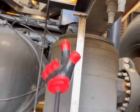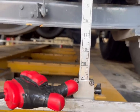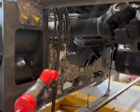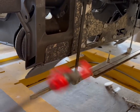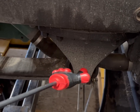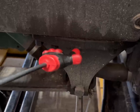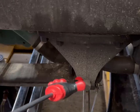Let's talk about gauge placement. The inside of the gauge needs to be touching the inside of the frame rail on both sides, and you need to be at the same line marker on both gauges. The back gauge should be slightly in front of where the front tandem is connected to the frame — this gives you a point of reference. The next gauge needs to be slightly behind the rear side of the front spring hangers. The front gauge needs to be at the front spring hanger. If you have a large cross member, you can hang it on the bolts themselves, since these bolts should be at exactly the same spot on both sides.